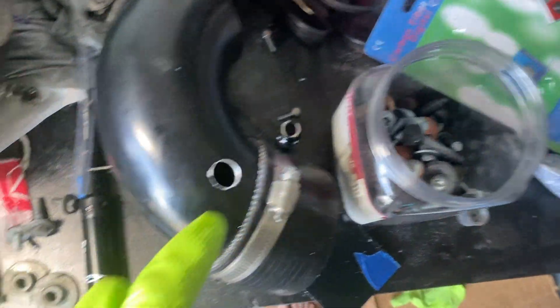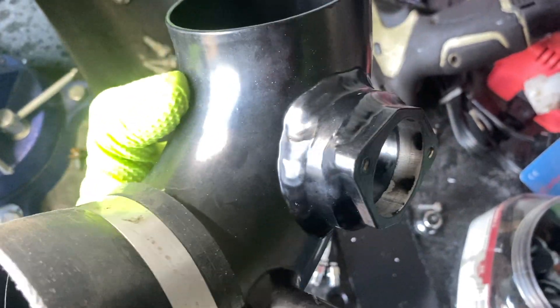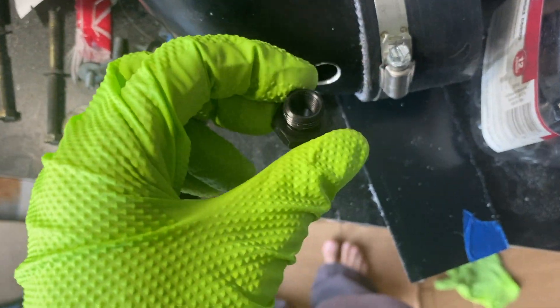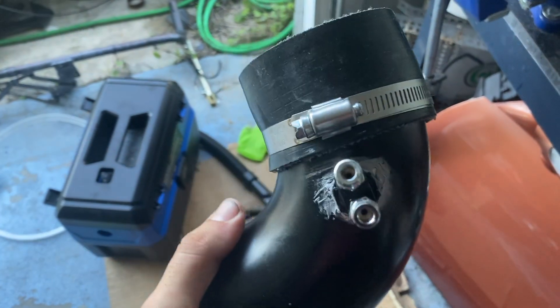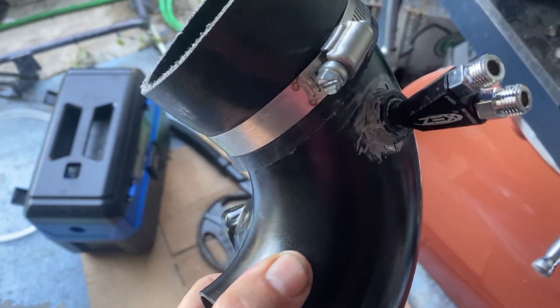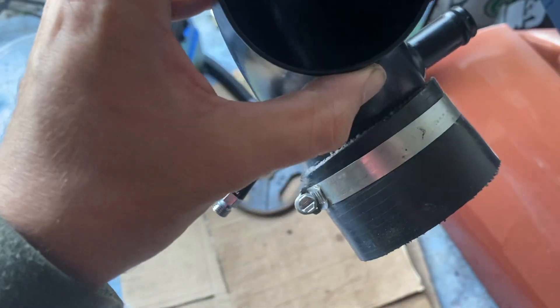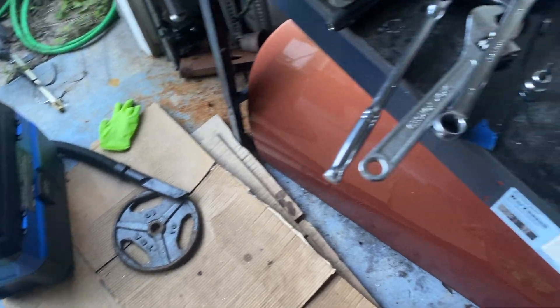The workbench is all set up — I got the hole drilled for it. Always make sure you do it after the mass airflow sensor. Now I'm gonna take the little bung that they give you, put some silicone on there so I don't get any air leaks, get a nice little seal, pop it through, and thread it right on. Got the bung on — I put a little bit of silicone; I wish I would've used black silicone but whatever. Nozzle's pointing down — it's a little bit off but no biggie. Just gotta put the mass airflow back on once this dries and then I can throw that back in the car.